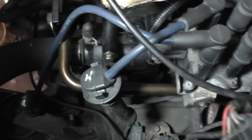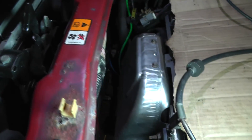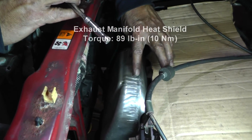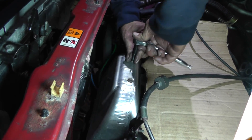Get your heat shield down in there - I got a new one here. Four bolts: two here, two down here. 7mm socket will take care of it - 89 inch-pounds as the torque spec. I also put some copper anti-seize on these, so I'm just going to snug it up. Alright guys, the only thing we got left is just putting the top of this engine together: valve cover, air intake, coolant bottle, fill it up with fluids, and we'll be cranking this thing up. So let's close this video out and we'll be seeing you in the next one. You take care.